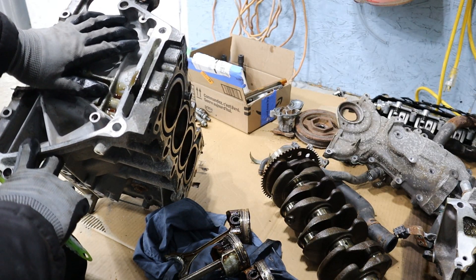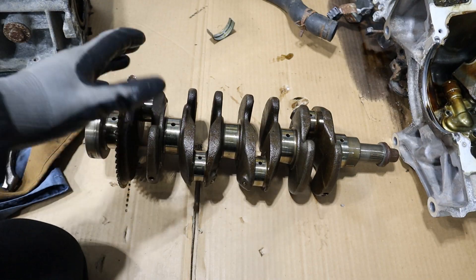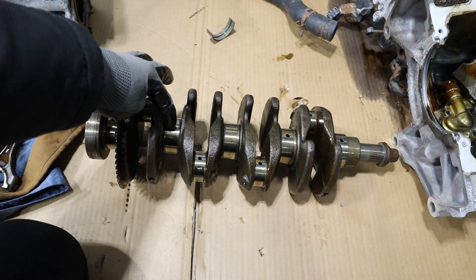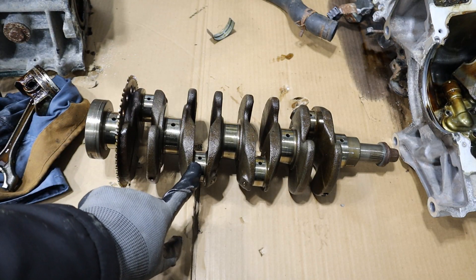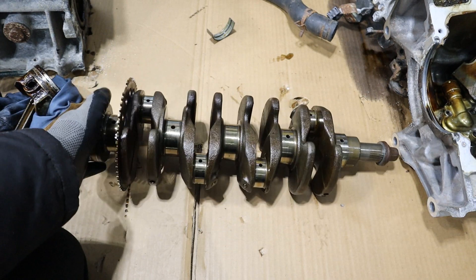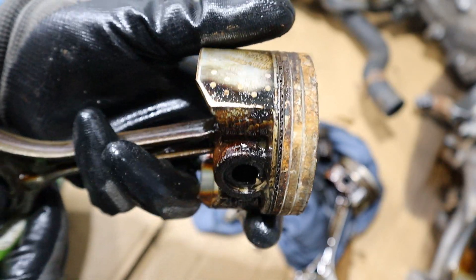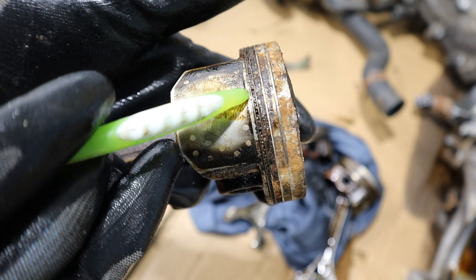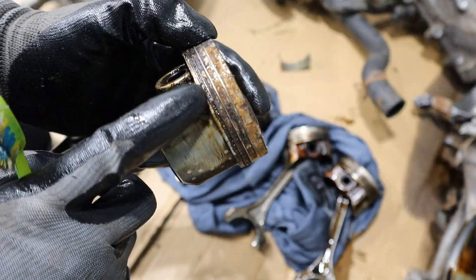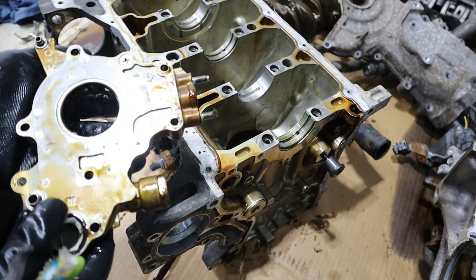We know Honda makes really good engines — or at least they used to before all the turbocharged stuff. The goal of all these components is simplicity equals reliability. Starting at the crankshaft — very simple design with nice large lubrication holes to lubricate both the main bearings and the crankshaft bearings. The counterweights are a reasonable size for a 1.5 liter engine and this thing feels pretty hefty. The pistons are a little bit crusty, the wrist pins are a bit on the stiffer side, and the oil control rings appear to be clogged with a little bit of carbon, indicating a high mileage engine that probably burned a little oil. The original polka dots on the side indicate they didn't see too much skirt wear. The oil pump is very simple — no extra chains — oil in, oil out, goes straight into the block.